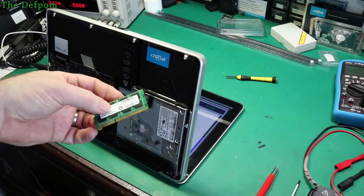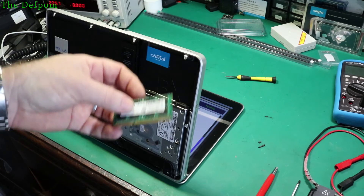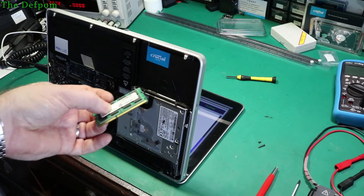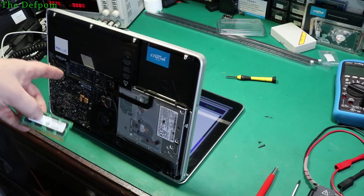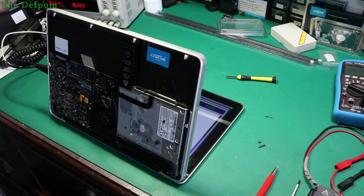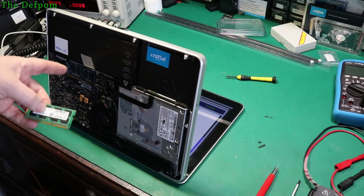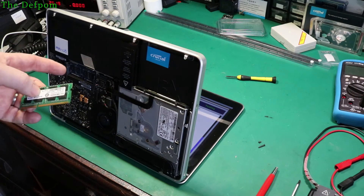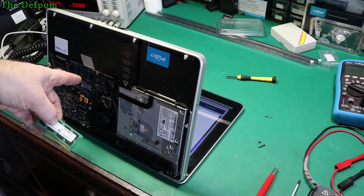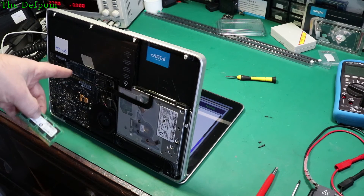So I got a screen come up with the system icon saying no system, which looked like it was going to start. But when I tried to put a system into it, I couldn't get it to boot all the way up — it only gave halfway. I found the other module is also playing up. It actually failed RAM tests. I got into the EFI version of ASD — it's a 2010 model, it's 138. And it said the RAM's got issues. It did RAM tests and it failed on about 5 things.